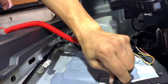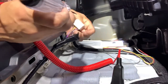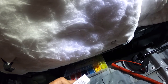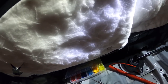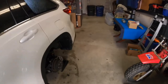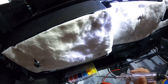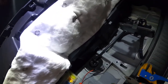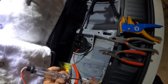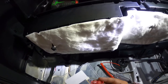We'll touch on here and see what comes on. The signal light is the yellow wire. So now we've got to figure out its turn signal. This is the smaller gauge wire, so we're going to use the red T-tap connectors for the smaller gauge wire.